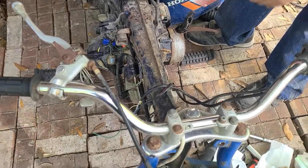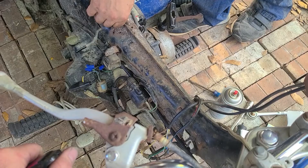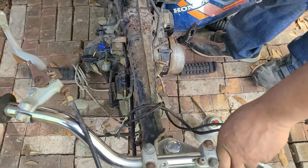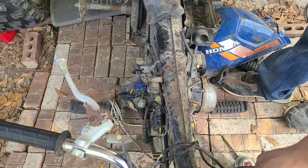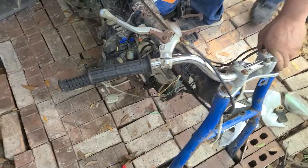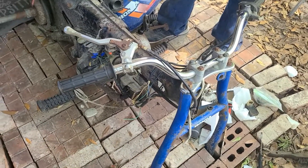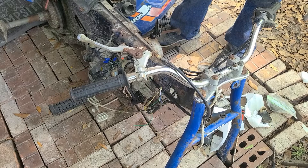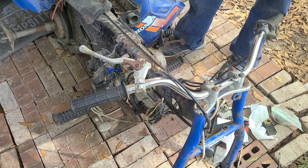So that's going to about wrap it up for the day. We got backfire through the intake. I mean, it's sparking, it's hitting, we got compression. The only other thing I can think of is the springs on the mechanical part of the CDI are gone — I got it wired wide open. I'm not really sure what that does, but I think once I get the springs for it, it'll fire up and run. Until then, just keep an eye on our videos. I'll keep y'all updated when I get the springs and we'll go from there. I appreciate y'all. If you're new to the channel, don't forget to like and subscribe.